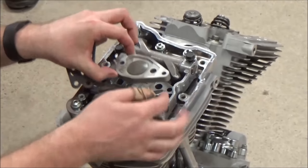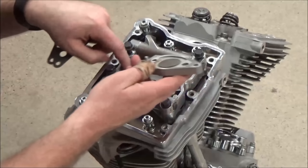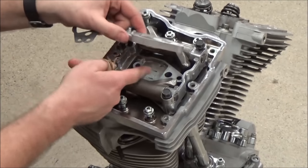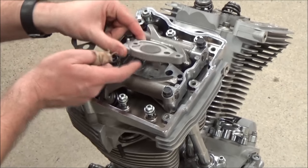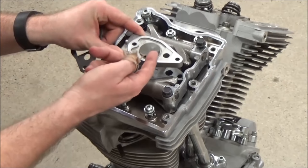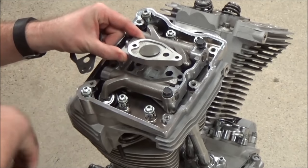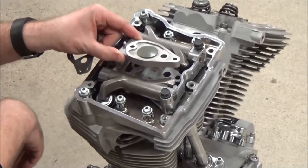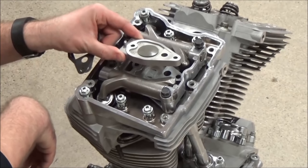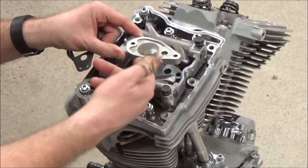Just seeing how this goes through, you can see that the air and oil are going through here. They're going to be stopped by the sponge, if you will. And then the air that gets through goes through here. It has to go somewhere, right? Because what's the air getting pushed by? What's creating all this air? The piston. The piston's moving what direction? Coming down the cylinder. It takes all that pressure in the crankcase. It has to go somewhere.